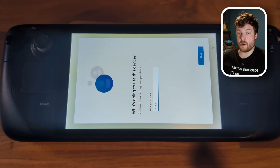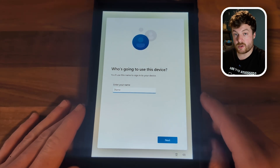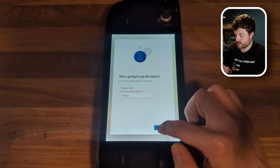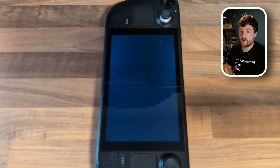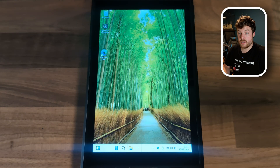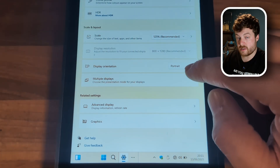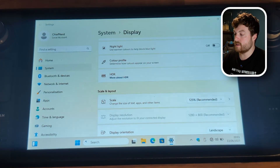Now we're in the Windows out-of-box experience. You may notice the screen orientation is incorrect — don't worry, we'll sort that out as soon as we get into Windows. You can bring up the on-screen keyboard by tapping into the text box and type a username. Tap off the keyboard to dismiss it. Type a password or skip it by selecting Next, and it'll do a bit more setup — almost there. Once you're in Windows, the first thing to do is fix screen orientation: long press until you see a box appear around your finger, let go — that's a right-click. Choose Display Settings, select Display Orientation, then select Landscape.